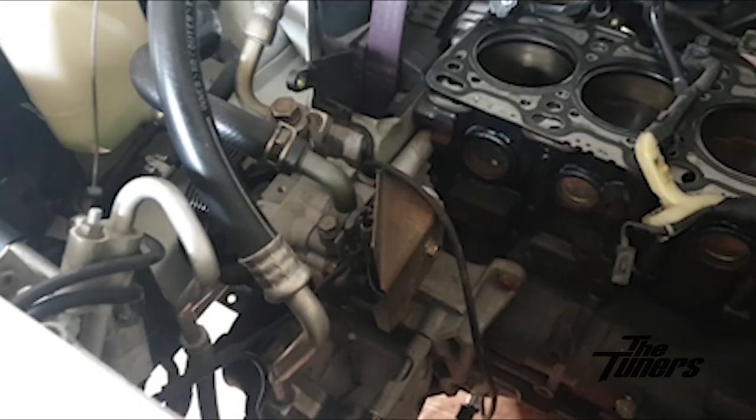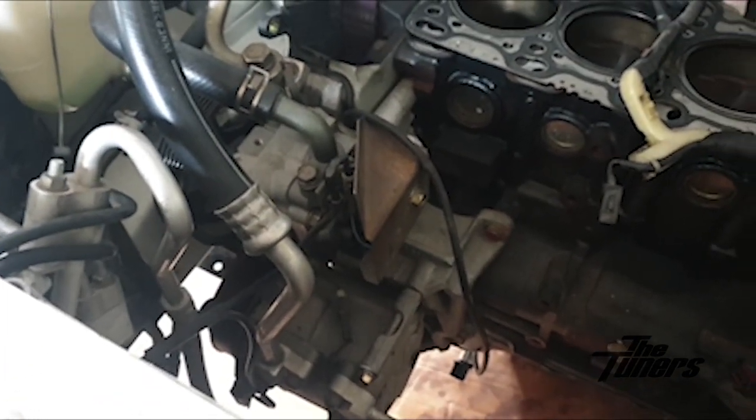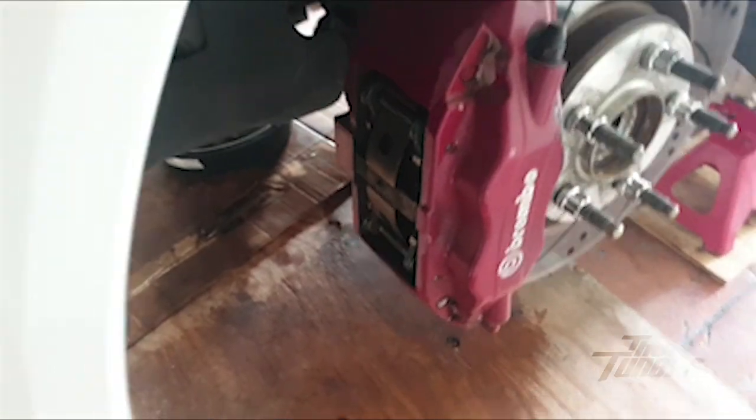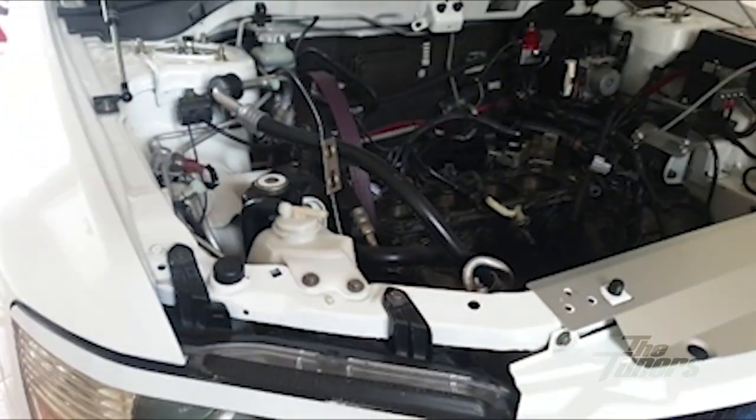All that's pretty much holding the block and the gearbox inside would be the mounting on either side. I'm leaving the power steering pump and the AC compressor — I'm going to hang them and just drop the block and the gearbox from the bottom. I'm actually going to tie the transfer case up and keep it inside as well. Axles and everything are out. That's where we're at — that's an update on the project.